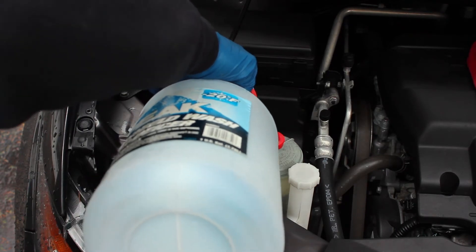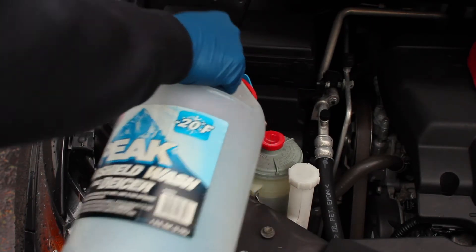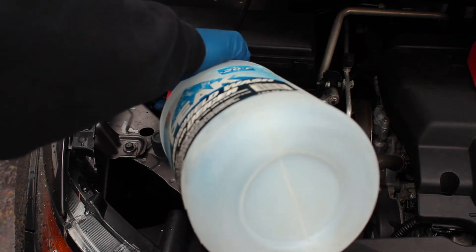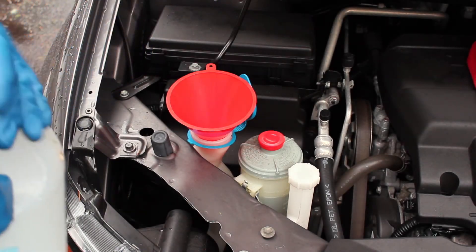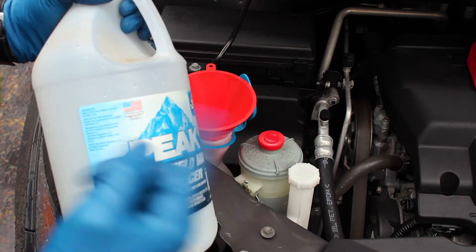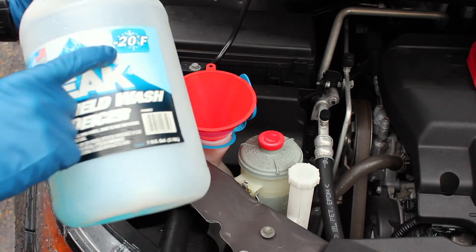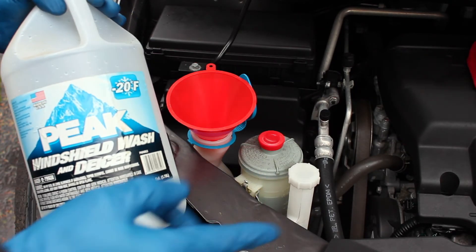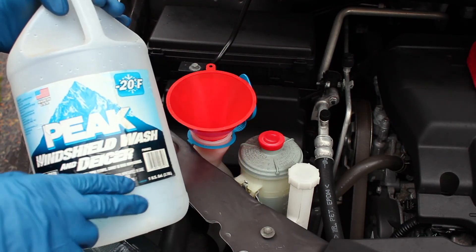So that's it — that should give me good washer fluid. I'm starting to see it back up to about where it was before. I'll run some through the lines and that's it. Hope this was helpful guys. If your washer fluid is freezing up on you, grab a $7 transfer pump and pull out the old stuff — or you could do the siphon suction thing, but you might inhale the stuff. Put in something that's minus 20 degrees and you should be good to go. Thanks for tuning in. Have a good one. My name's Luke, I'm a rank amateur — if I did anything wrong, put it down in the comments below. This one didn't take an hour.